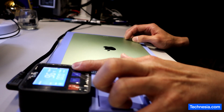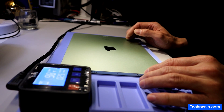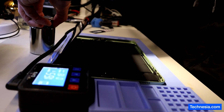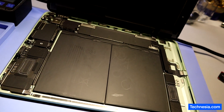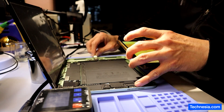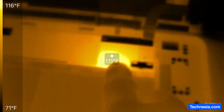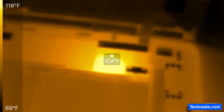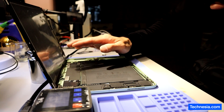I'm heating up the iPad so I can remove the screen easily without breaking the new screen. Here's the iPad — I'm going to let it cool down a little bit and then start working on it. Checking under the thermal camera, I can see there's a heat spot right here on the board. Let's take apart the iPad and inspect the logic board.